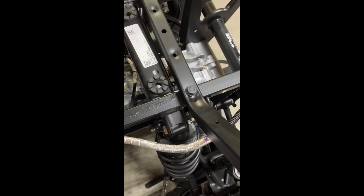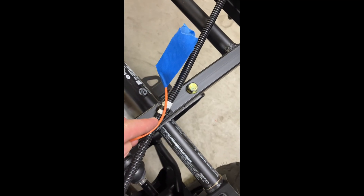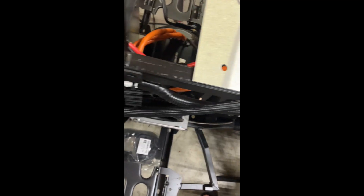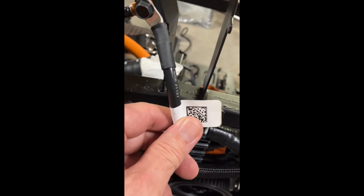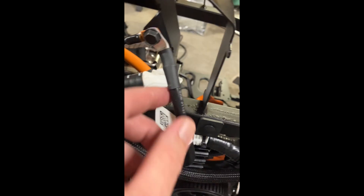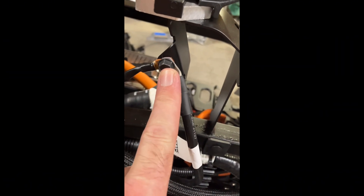Now I'll go over the connections to the bike, starting in the back. This orange wire gets connected into the brake light circuit on the orange Polaris wire. Your ground is the black wire — I take the Polaris ground wire that was on the starter and mount it up where the coil usually goes, using the same bolt, then attach the new harness to it.